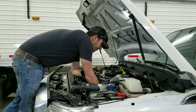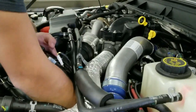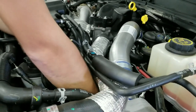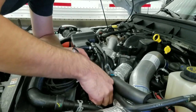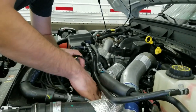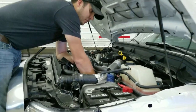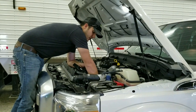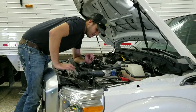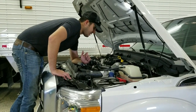Just go down and put the female portion of our harness into that injector plug — you'll hear it click. Then take the male portion of our harness and plug into the female portion of the factory harness that you unplugged from that fuel injector port. Everything clicked in. You can see it with a flashlight and you can also feel it fairly easily with your hands.